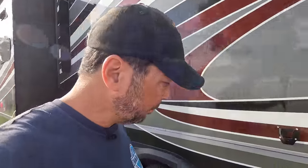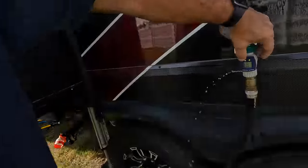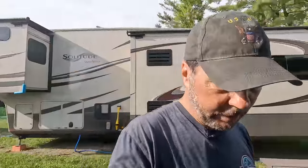When I'm doing that very first keep-flushing step, where I wait until I see clear water out of here, I will reset my meter and set a timer for 10 minutes. 10 minutes, counting down. My point with this is, even though it's open right now and just flushing right through, it's not gonna fill up, there's no danger of it overfilling. I like to have that 10-minute timer, come back out, look at my meter. That gives me an idea of how long I will let it go when I have the gate closed and I'm filling it up to flush. Timer's done. Let's go see how much water we used and what our flow looks like. 27 gallons, which is pretty good.